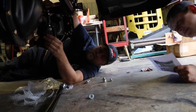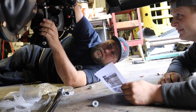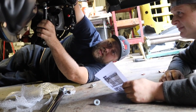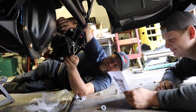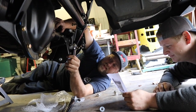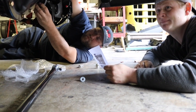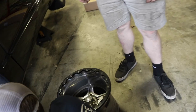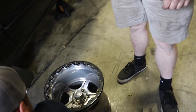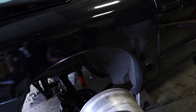The problem with radial cars is it extends down — you want separation — but on pro mod cars we run short ones. When you get extension on those things they will lock out, so you've got no shot. It doesn't do anything, it locks out and wrecks you. You need to get the rear end in the ride height position and then weld the tabs on. So Jamie brought his Billet Specialty wheels over — wrong size though. He's got 10-wides on Godzilla and it's going to hit everything — straight into the lower control arm.